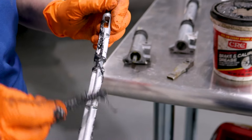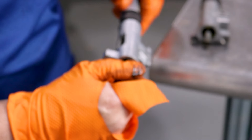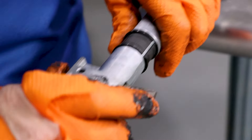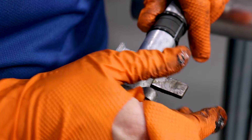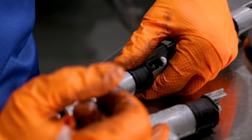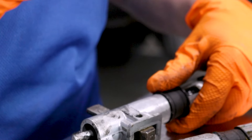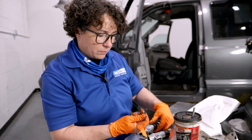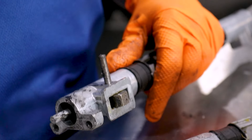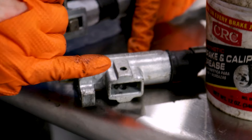Now we're going to grab the new tube and put the plunger in. Before I put the plunger into the steering tube, I load it up with caliper grease or white lithium grease — not the spray, but if you have a bucket of it. You just want this plunger to move smoothly in and out. You want the point on the side that the spring's going to be on. These are the ears I'm talking about — facing down, facing down. You want the knurl part to be on the top, so the pin must go this way through. If you put it the other way, you'll only get from park to reverse because the pin will be sticking up and hit the bracket.